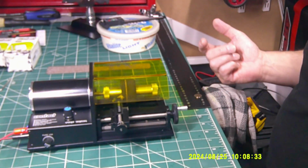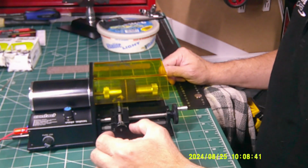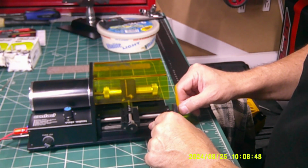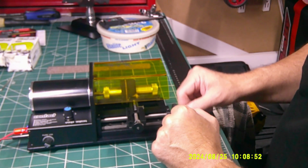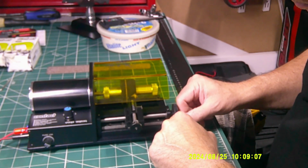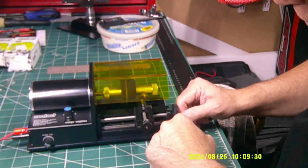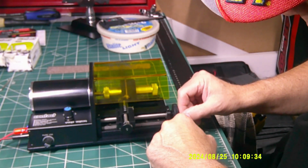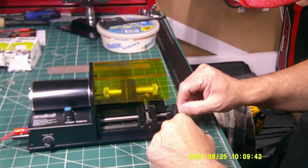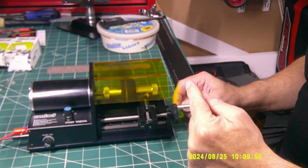And I perhaps want to go down to, maybe I'll take, I don't know, I might not go down to what I'd race it at, but maybe I'll go down to take a mil off if I can. That's another 0.2. And it's just sort of starting to touch the tyre there. So I'll keep doing that until I've got some meat off the bone, as it were. So it's just got slight resistance. When you're going quite slow, I know you can probably go quicker. Making sure you go fully across the tyre and off.